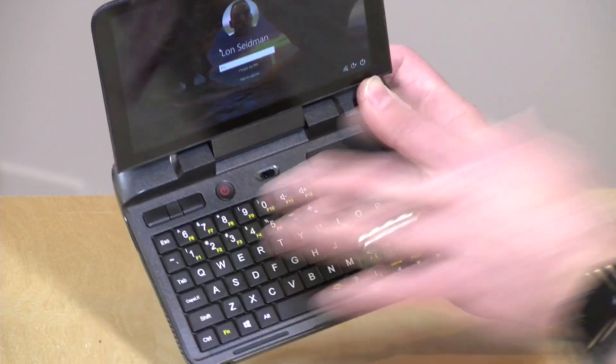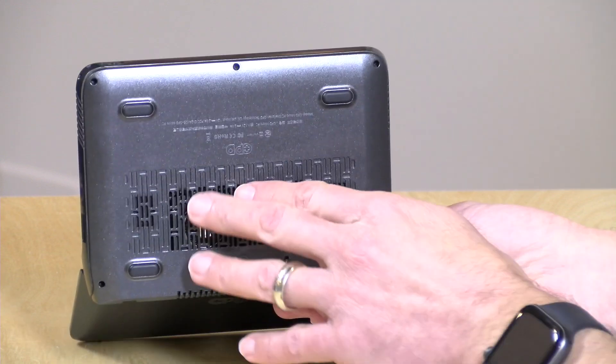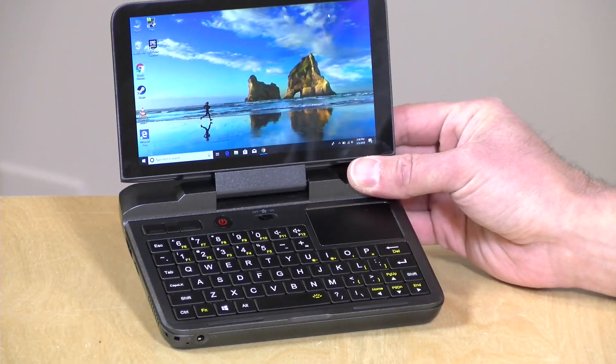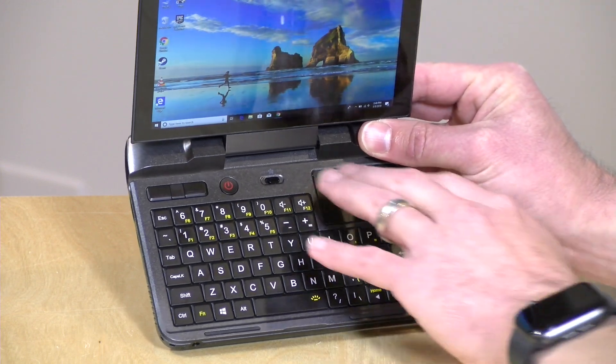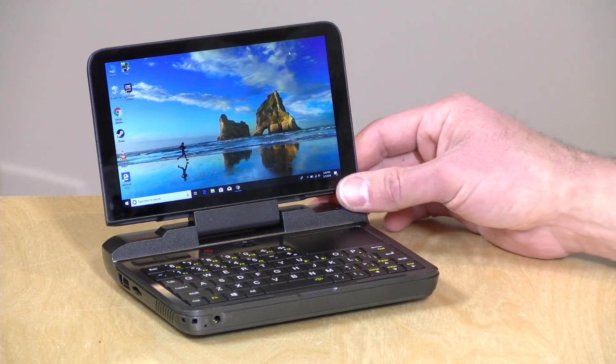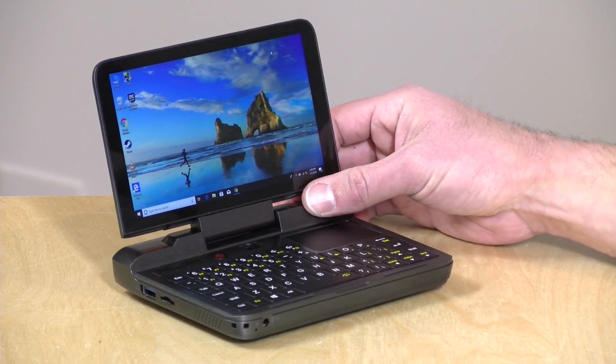You might see the computer throttle a little bit with the fan off, but if you're only using it as a terminal device or for occasional web browsing while troubleshooting in the field, you can switch it off without much performance impact. It's only when you really push it that you want the fan on. The fan noise is not bad but you will hear it — a bit of a whine from the tiny fan — though in a quieter setting it's noticeable. These Gemini Lake chips are efficient enough to work reasonably without active cooling, but for best performance keep the fan on.